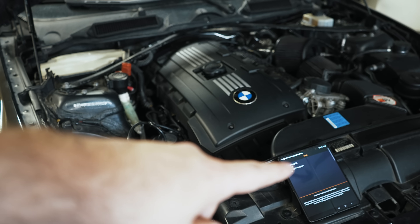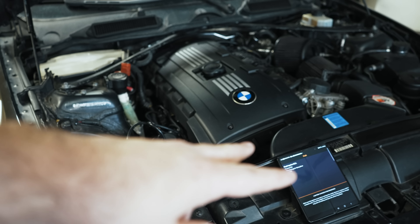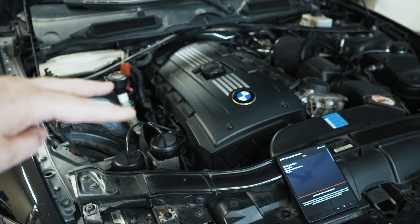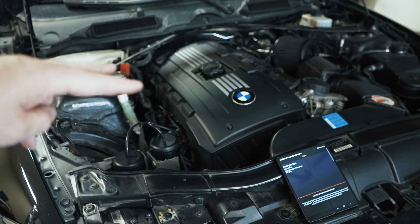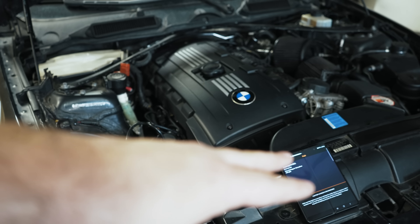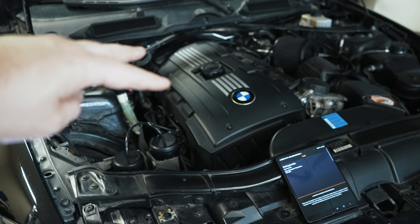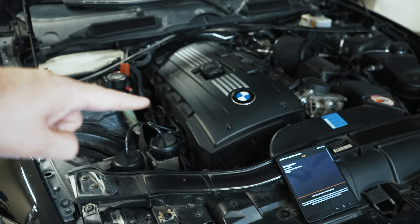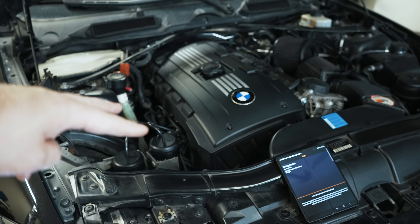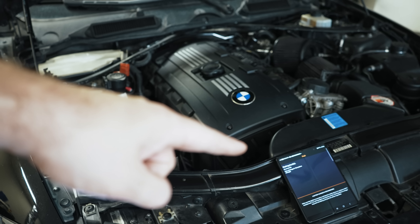As shown when I selected that option, it says for OTS (off-the-shelf) maps only — if you have a custom tune you need to talk to your tuner to integrate it, which I plan to do when I go single turbo. You may wonder how I'm running upgraded turbos on an off-the-shelf map — ultimately you're just running less boost, so you won't get the full benefits of them. The O2 sensors can compensate for the 10–20% more flow at lower boost with no problem. I've been running 93 and once the flash is done we'll go to the pump.